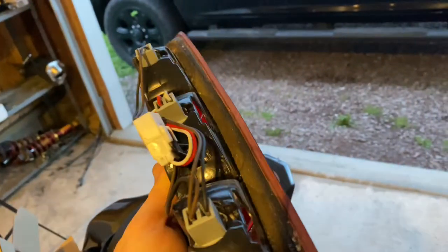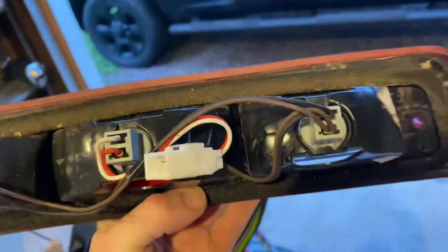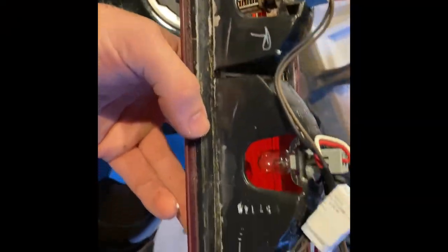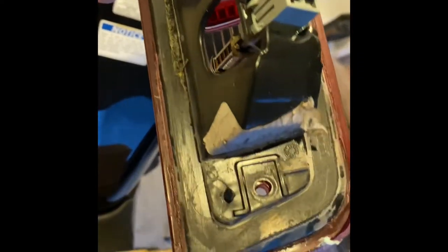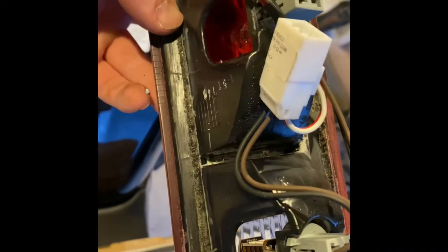No thickness. So I'm going to take a razor blade, I'm going to scrape this off, and I'm going to take a Goo Gone remover and I'm going to clean the surface really, really well before I ever lay that new gasket down, and I'm going to do that on the same spot up there. To get that gasket off was actually a lot more aggressive than I thought I needed to — I actually ended up going to, like, a wire wheel on a drill, and that ended up getting it off. It didn't look like it scarred it too much, and even if it did, personally I don't care — this is strictly an inspection thing for me right now. I am 100% going aftermarket, but this is basically where you want to be at for right now.